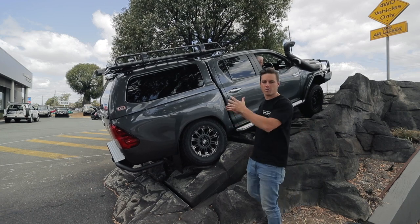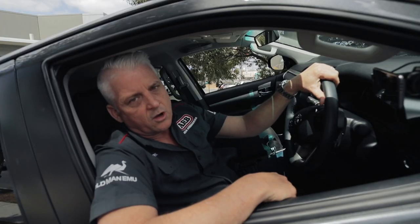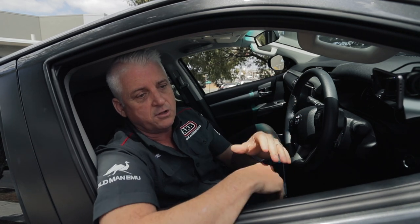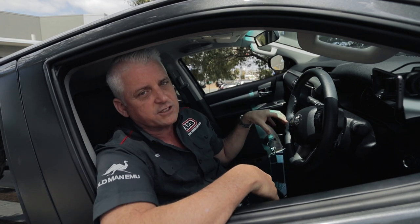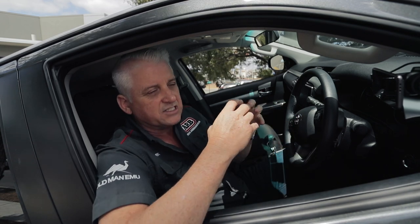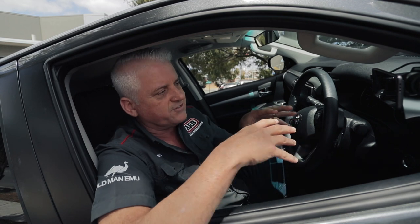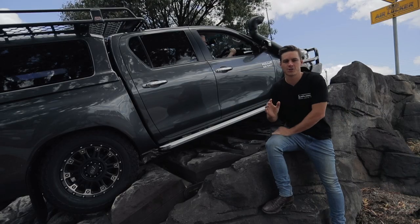As soon as it runs out of travel, front and rear wheels have started spinning. Mark, run us through exactly what's just happened. All right, it's a pretty normal situation off-road. We've attempted to drive up this simulated hill — could be a sand hill or a dirt hill. A lot of consumers believe they have a four-wheel drive and that it drives all four wheels. It's in low range four-wheel drive, both tail shafts connected and turning, but unfortunately when one wheel on any axle comes off the ground you've lost drive to that whole axle. When one wheel spins it looks like it's driving, but it's actually spinning in mid-air — all the power is delivered to the wheel that's in the air, or in mud, or in sand. We're stuck halfway up this hill due to lack of traction.